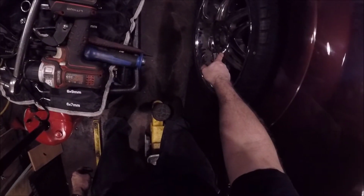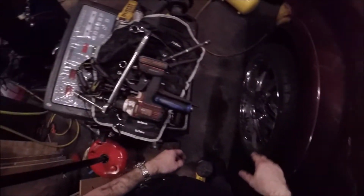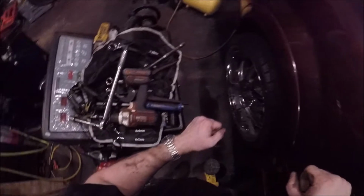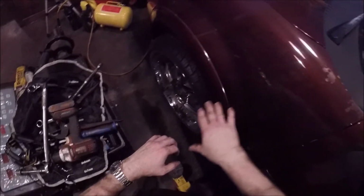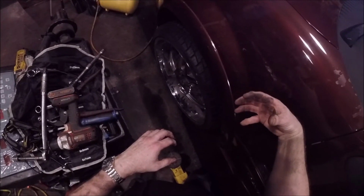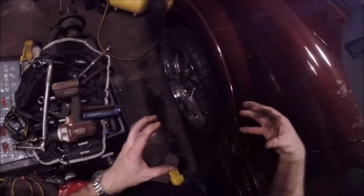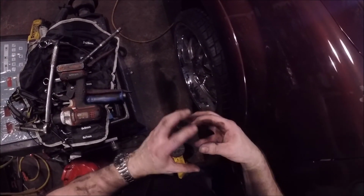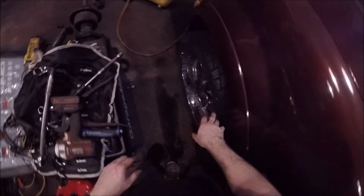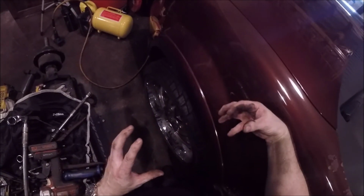And last thing on that lock nut. Make sure that you feel it draw it in. Ideally, what I try to do is do it with the wheel off, and you want to put a pry bar on the lug nuts, and maybe have somebody hold the axle itself on the inside with a socket, and then you want to torque it out, and you'll see it draw in. You want to make sure it draws into that axle seal so that all the gears line up. Otherwise, you're going to have slippage. And you know you've done it right if you take the wheel back off, you spin the hub. The hub should lock in by default to that axle. Anyway, just keep that in mind.